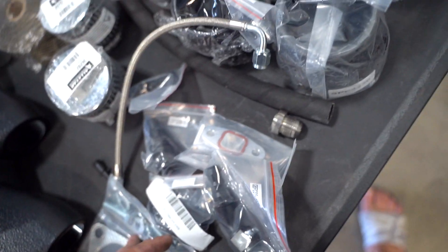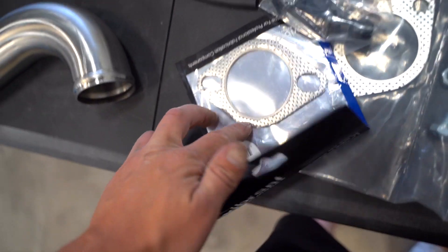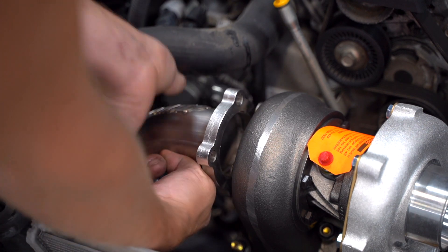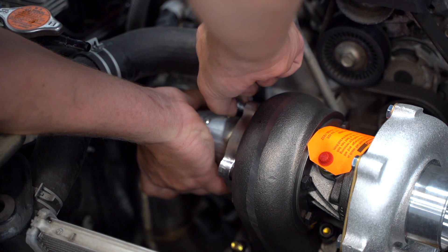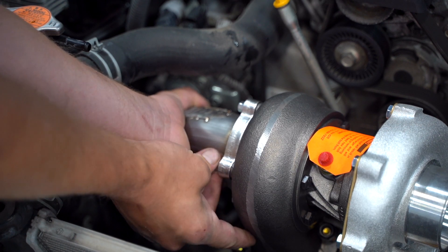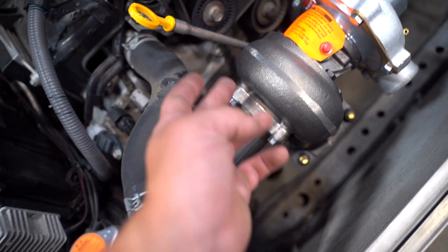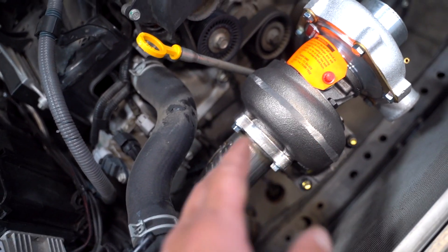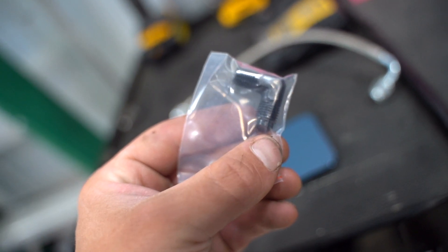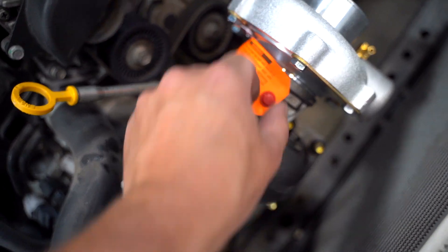I'm not seeing the gasket — that sucks. This gasket here is for the down pipe to over pipe, but we need one for the turbo to down pipe, which is not here. The down pipe is on kind of temporarily because we do need to get that gasket in there. I'm going to figure out where the oil feed line goes. I think we pull that plug out on top of the block — they included an oil feed line and a little elbow that should thread right into the block and connect to the oil feed line running to the turbo.